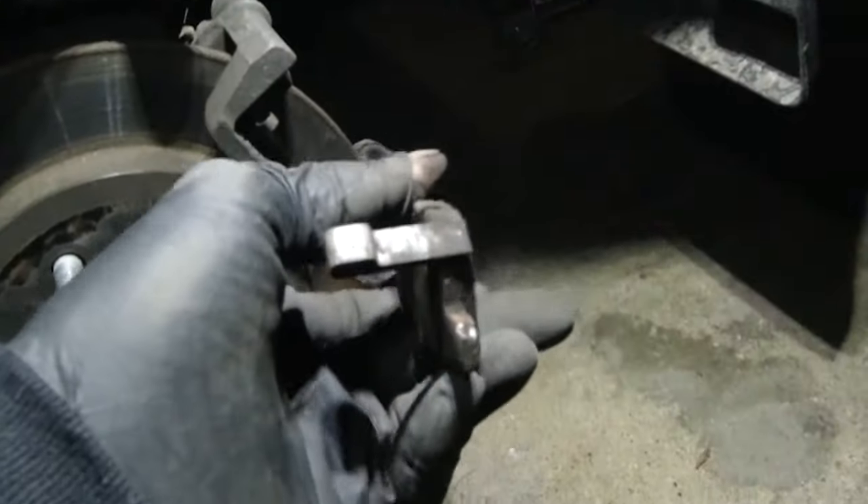Scrub these out and clean them just a little bit — it's not good to breathe in brake dust. Put the wheels back on. One more very important step: when your brakes are back together — both inboard and outboard pads on — always get in the car and pump the brakes so you have a nice hard pedal. That gets those new pads right up against the rotor so when you hit the brake, the car stops. You want those pads nice and right up against that rotor — not moving. Put your wheel back on and you're all set. Don't forget to test drive it.